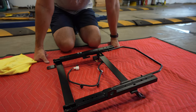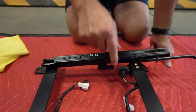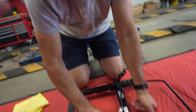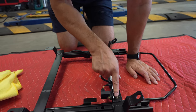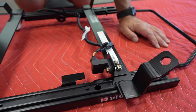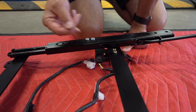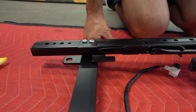Let Victor explain the driver's side setup. We bolted on the factory piece that comes from the donor seat — this is the metal plate and the magnetic pickup. We bolted it to the seat, then made a little bracket, bolted it on, notched the bracket, drilled a hole, and put the magnetic pickup in there. It's all bolted on — no welding, so you can remove it or reuse it. As soon as the rail gets close to the pickup, it detects position and adjusts airbag deployment accordingly. Going all the way back and forth, nothing rubs and nothing touches the slider mechanism.